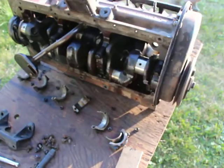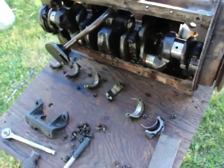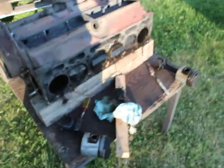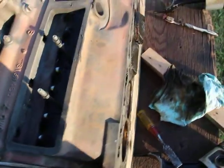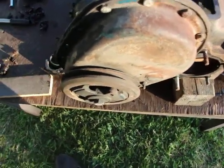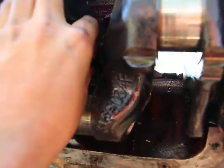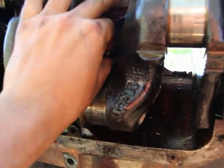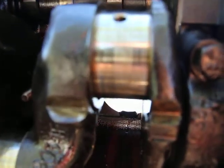So this is the other engine that I managed to buy. It's another 195.6, except this one is the OHV — the overhead valve engine. The top is slightly different. There are the lifters inside; I've already cleaned it up quite a bit, it was absolutely not like that when I got it. There are all the lifters, they all turn freely now. The crank wasn't turning really well — it would turn just a bit, so it was seized. And that piston in there, it's kind of seized onto its pin — it's not turning around its pin. There is oil, and the crank doesn't look too bad, but it doesn't look great either.